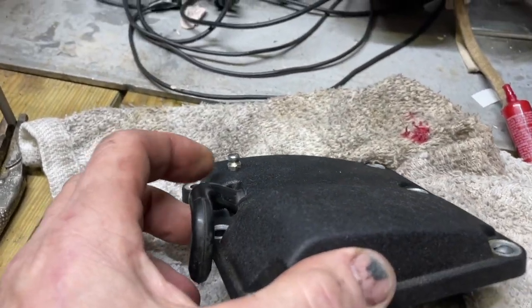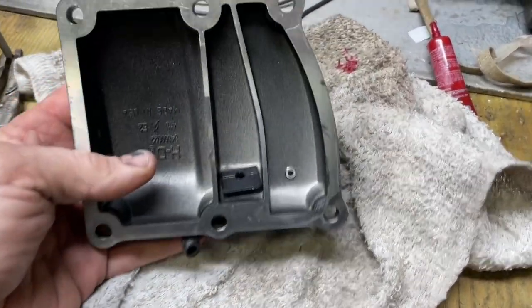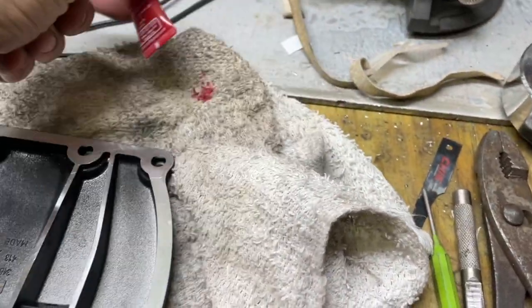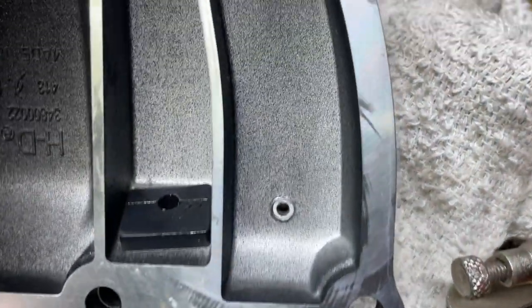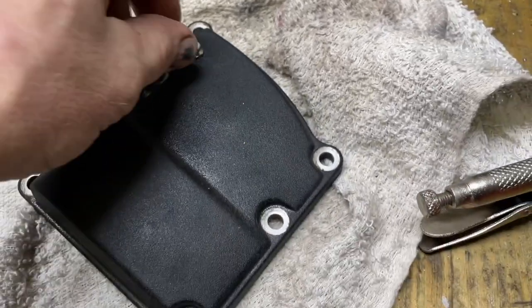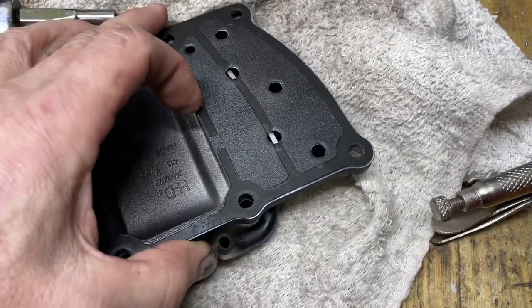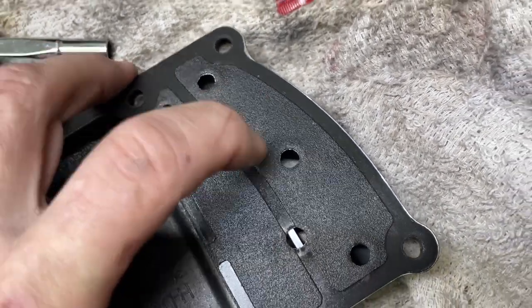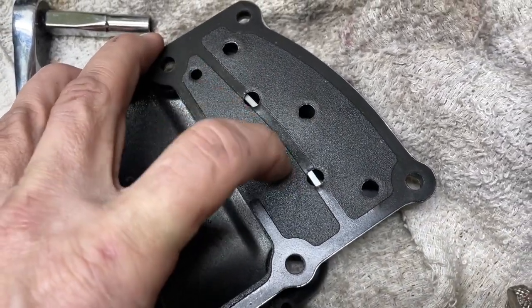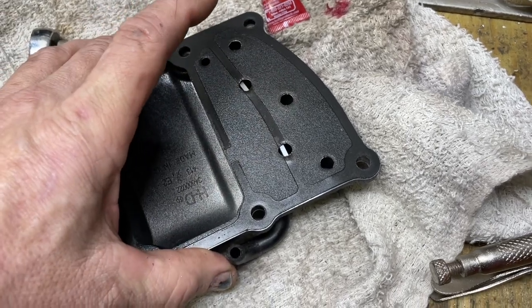Here's my version of the fitting. I ended up using a zerk fitting, drilled out and ground off the edge to get the spring and everything out — you can see it poking right through there. I used some Loctite as a sealant and drilled and tapped for the fittings. Now we've got a nice fitting that's popped through that we can attach the hose to. With this gasket in place, you can see those two cut-out circles are going to allow the vapors to go from chamber to chamber to get over to the vent side, and the other holes allow the oil to drip back down into the engine.